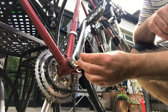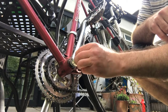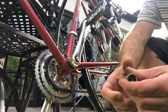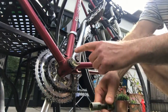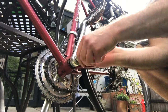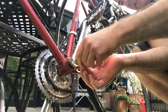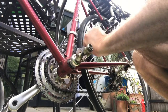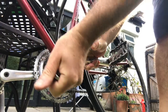This is the more usual bolt type, but the ones you've got are much more convenient, a bit more advanced technologically. You just screw it in and, using an Allen key — one of those hex wrenches — you screw it up. Screwing it up draws the taper. You have to do it pretty tight actually.